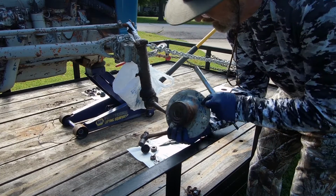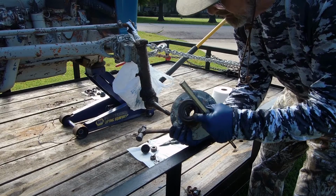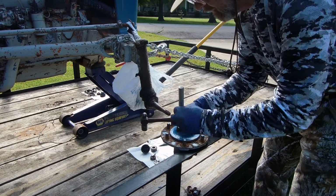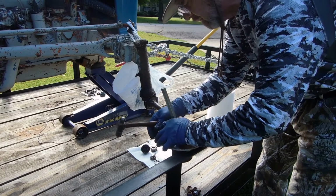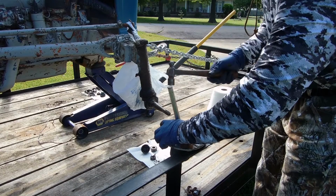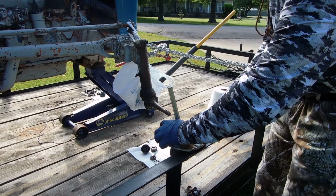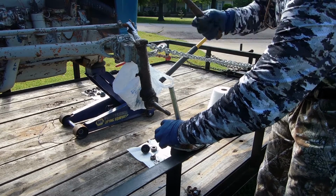You say, what are you doing? I'm trying to drive this seal out using the bearing. And I've loosened it a little, as you can see right here. Difficult holding it up on this edge without any support on the bottom, but if you supported the bottom, you'd not be able to drive it out. You'd just be driving against the bottom.